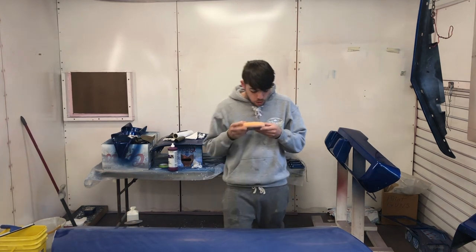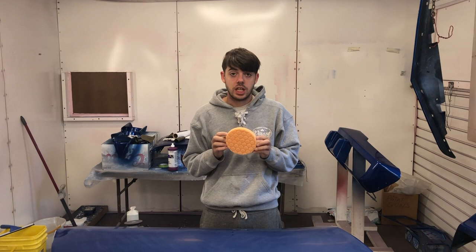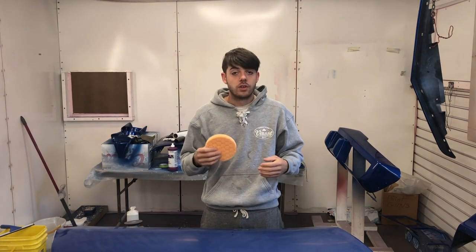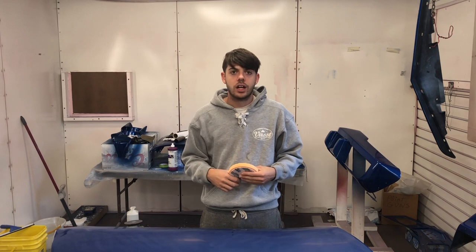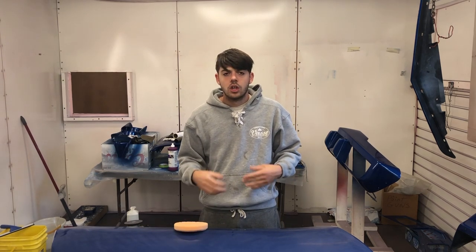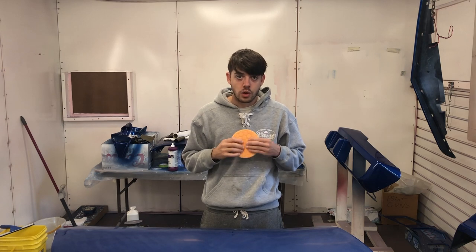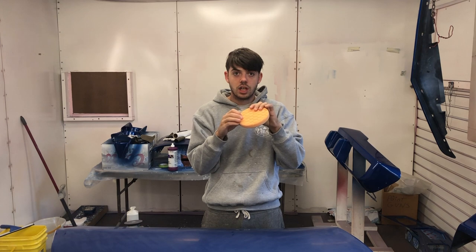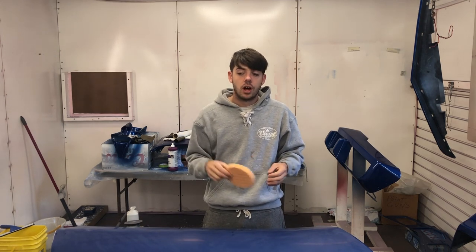For that, I'll be using this orange pad. They do make a more aggressive one, which is a yellow pad. For the most part, this orange will do everything you need it to do. But if you're buffing with the orange pad and just not getting the look you want or not getting some scratches out, go ahead and knock down to the yellow, hit it with that, and then come back to the orange. You can also use what they call a wool pad, but we've always used foam pads and they do good. One note on foam pads: when they wear out, they don't do anything. When you first put them on they'll cut well, but the way you tell if it's worn out is when the edges of these hexagons start to get really fuzzy. Once they get really fuzzy, these are no longer cutting and you need to get a new one.